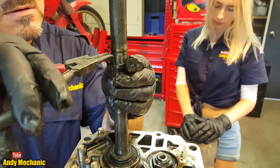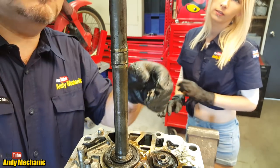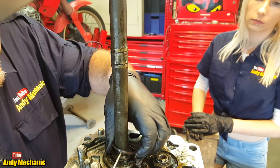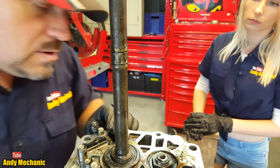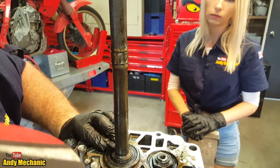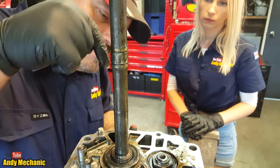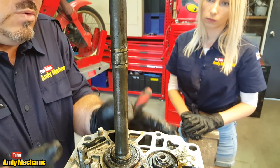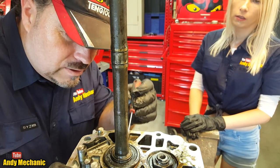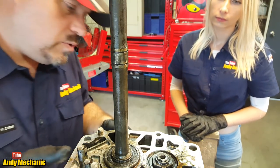Nearly. Right, that's that one. Jeez, I've got some washers. Okay, and what else have we got? Another spacer. And it looks like some kind of split spacer, but I think that can now stay in. I think what will happen when we split this next bit off, that shaft should go down and this cover will lift up. It's not always the case. Sometimes, you know, gearboxes are built differently and you just got to go with the flow. But we saw that bearing spinning, didn't we? So we know it's loose in the casing, so there's no reason why it shouldn't.